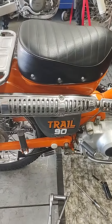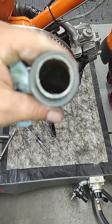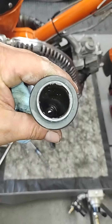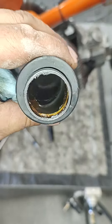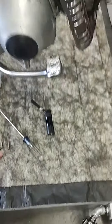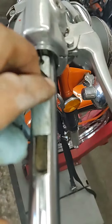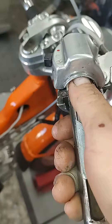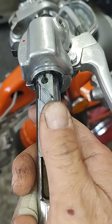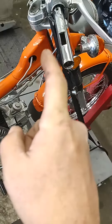1973 Honda CT Trail 90 throttle issues — here's why. Somebody used grease in here, but this one should be dry. Lubing it up and lubing the track is not a good idea. I just cleaned all this stuff off so that throttle cable will actually move. Now I can pull it by hand. That's how the throttle cable is pulled — it has a spiral on the grip and it spins around.